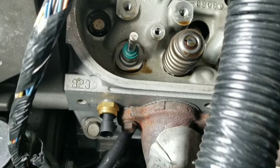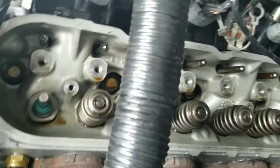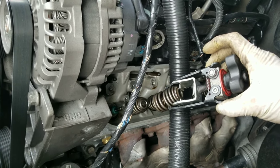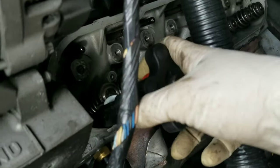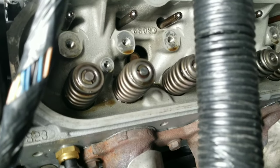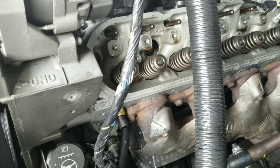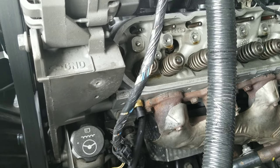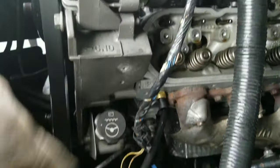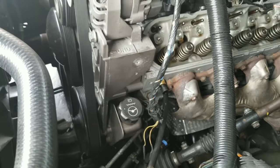Now time to return the spring and keepers, and do the same thing to all the rest. Just gonna go to the spring right here and install it. The valve seal is back in, remove this one — and voila, that's the first one done. Time for the next one. As you guys can see, this is how it's done. You guys can remove the valve stem seals with the head on it, head on the engine. It's all good, don't be scared — get all the parts you need, just follow the instructions and you'll be able to get it done. Thanks for watching.